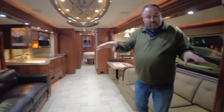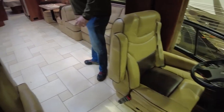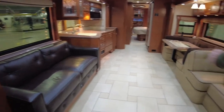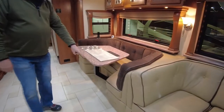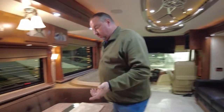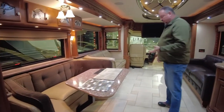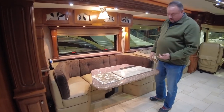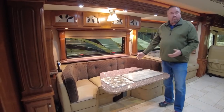We're going to redo the driver cab seats in a different material, with Country Coach logos seamed into the headrests. From a furniture standpoint, the furniture will stay the same — we're just going to redo the fabrics and foam on both pieces. We're redesigning the dinette so it's one seamless piece, and the two bottom pieces will become drawers for more storage. The table slides on a slider, which they really like. They've asked us to engineer a motorized pedestal so the pedestal moves in and out along with the table. We'll put a switch underneath to control it — something we haven't done before that we'll engineer ourselves. I'm looking forward to that particular project.